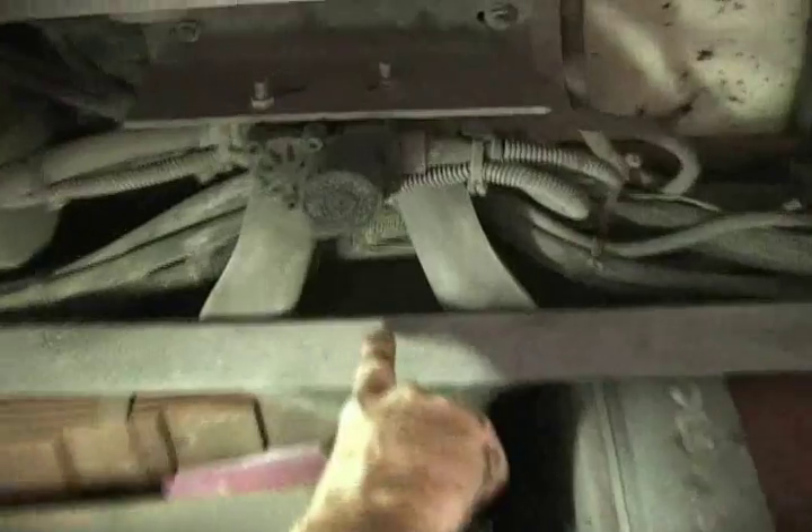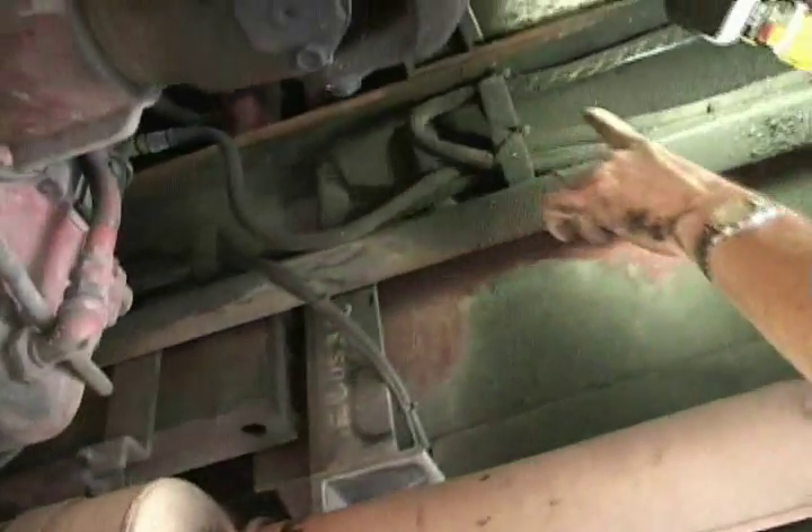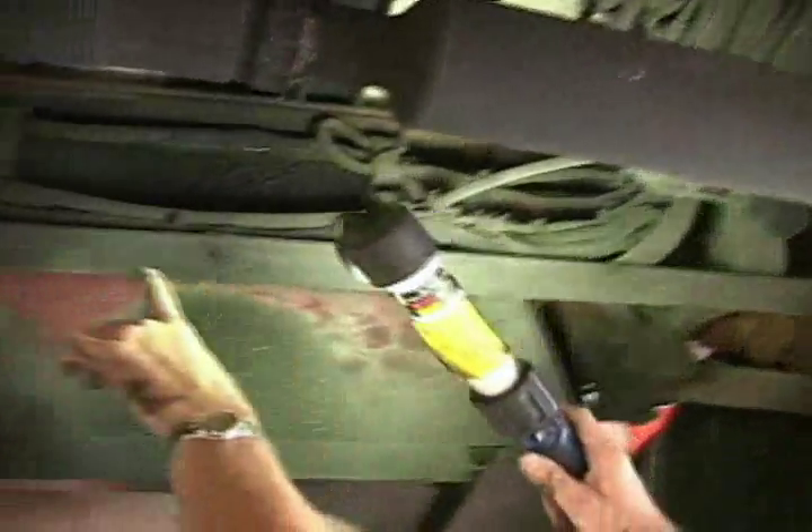The rear spring stack is the same design as the front of the truck, only much heavier because of the weight on the back. You want to inspect these U-bolts, make sure they're in place, and take a look at the spring stack — it should be undamaged and bolted to the frame rail. There should be bolts that hold the spring hanger to the frame rail in this area. Notice right here there's a crossmember that attaches this frame to the other frame — this is a high stress area where the front of the rear spring is attached. You should be looking at the frame as you work your way along from front to back. There should be no signs of cracks or any damage to the frames.